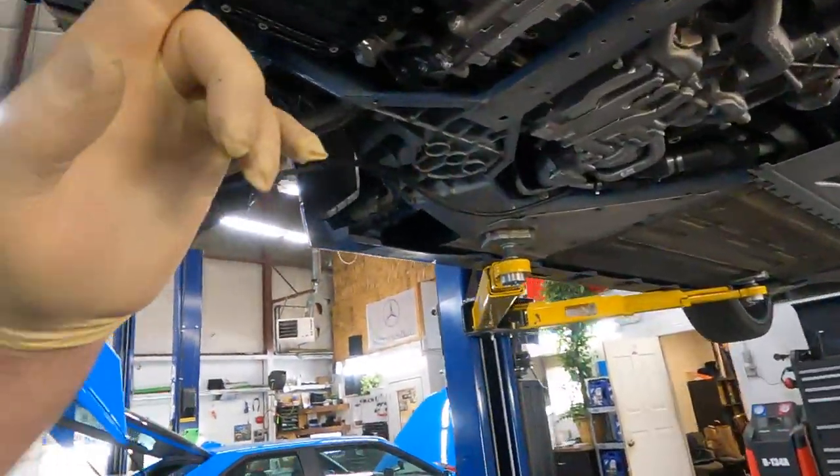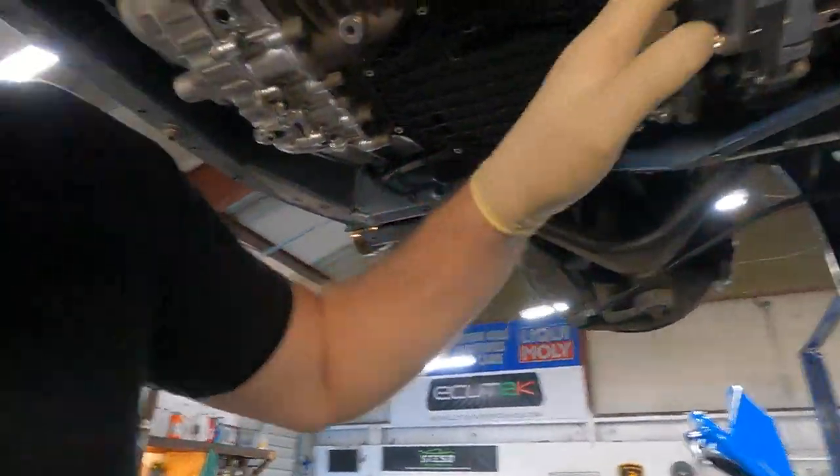You can just — I don't know if you can hear — but not any sound from that flywheel now. It's actually good. Everything looks good. We need to finish assembling everything and take it for a ride. I'm glad we diagnosed this properly. It was the flywheel — the first time I've seen that on an Audi R8, but yes, it was the dual-mass flywheel.